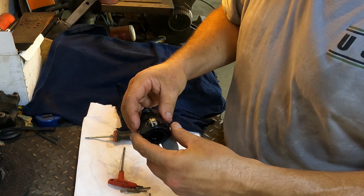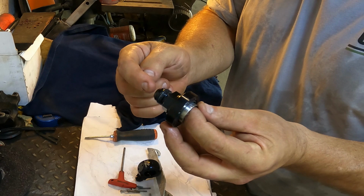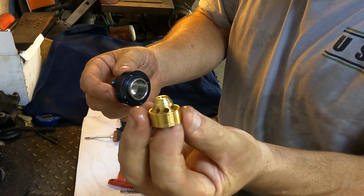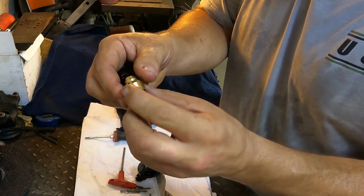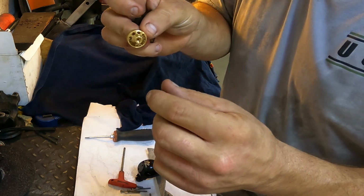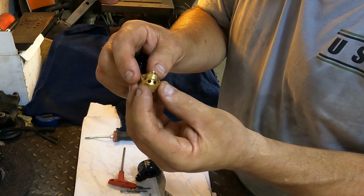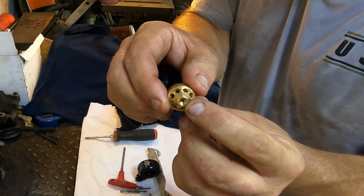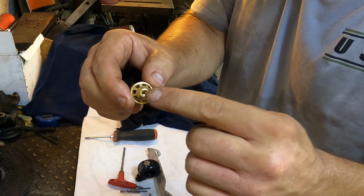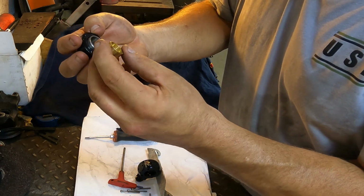And then, let's look and see what we got on the other side. And you'll see, this was the inflow right here, so fuel was coming in here, and look, we've got a baffle right here. The spring was sitting against this, and see it's cone. So these holes around here, when this is pushed all the way up, none of these holes around the edges are getting fuel. But look, there's a pill in the middle of it like a jet. Okay, so that jet's open all the time. That's for a belt drive pump. And so, there you go, got a hole in the middle of it.